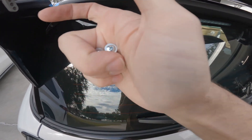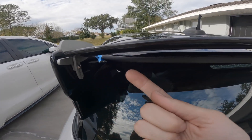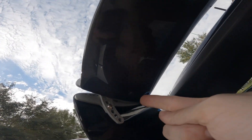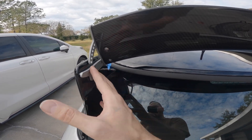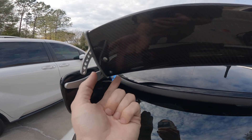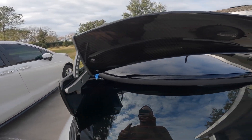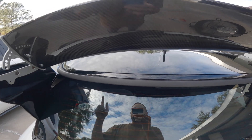It comes with four Phillips screws, so it's super simple. Do not over-tighten this stuff — I see a lot of people try to torque down into carbon fiber, which is not the smartest idea. Just hand tighten it and you should be good to go. The screws go under here — into here and here on both sides. When I went to install these, they wouldn't line up perfectly, so what I had to do was remove the piece completely, push it all the way forward into the forward position, screw it in, and then make adjustments. Don't try forcing anything — just push it all the way forward first.